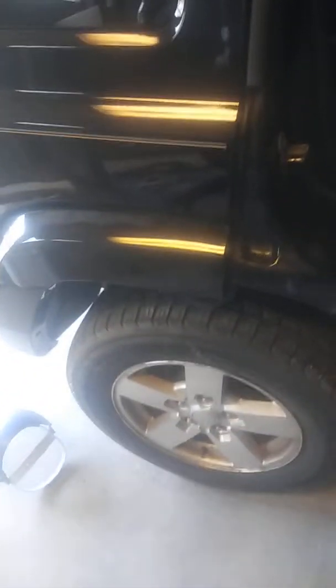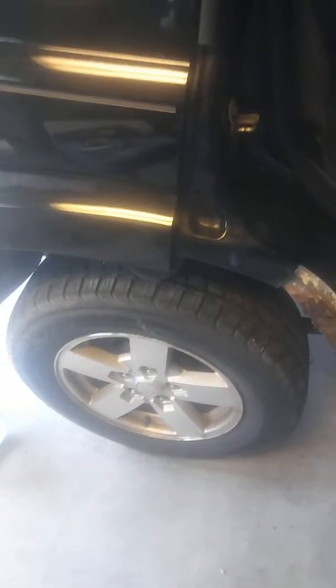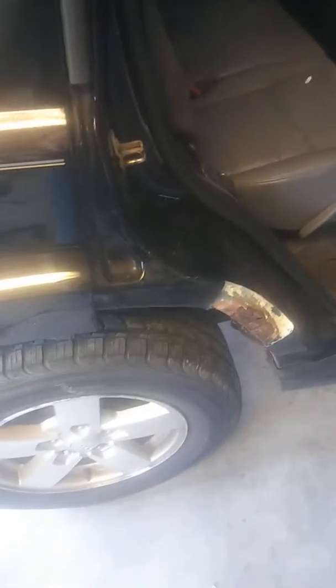The cheap Harbor Freight shrinker and stretcher does me wonders all day long, because most of the time you're not going to find a dog leg for a patch panel unless you buy, like this Dodge Dart I always mention. I bought that whole Uniside and just cut out the rocker on it. It was too new to find any patch pieces for it, so I did the whole rocker all the way up front. Long story short, but that should be up on some of my other videos if you scroll back. If you go way back, you'll see a '71 Nova where I actually fitted a junk, real thin tinsy fiberglass front end, and reshaped everything and fiberglassed it and round barred it. But I'd rather make something or fix something than be a parts changer, unless it's beyond fixing.